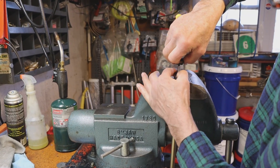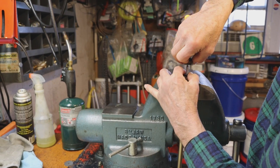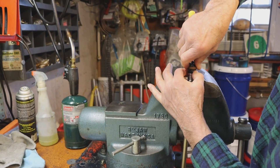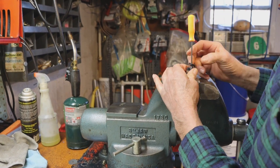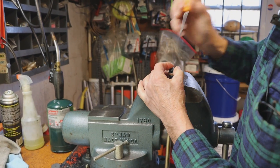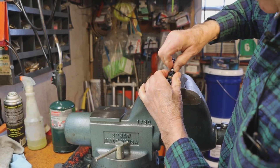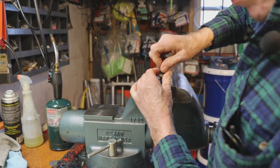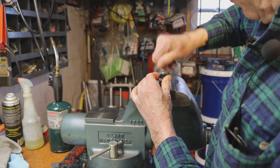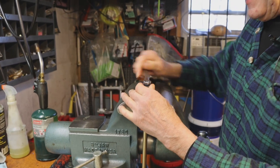It's obvious in hindsight — I used to change springs in my forks or shocks, and I would end up with the right spring but usually over-damped. So I'd have to take them off and send them to you to revalve them so everything was in balance again. Then I learned my lesson: now I just send them to Drew in the first place and don't bother doing anything else.